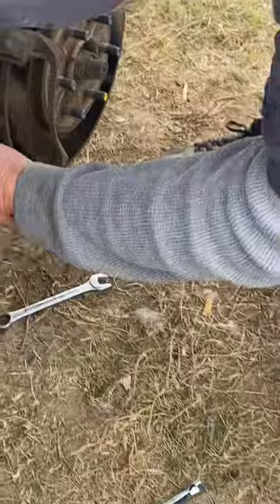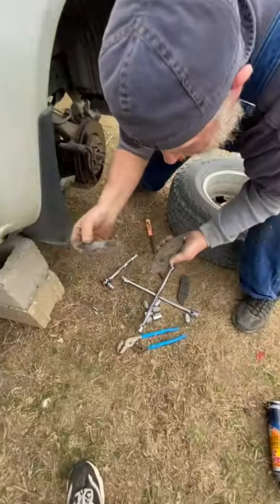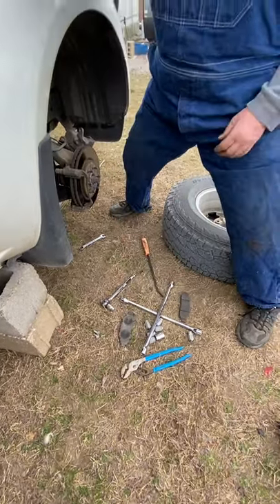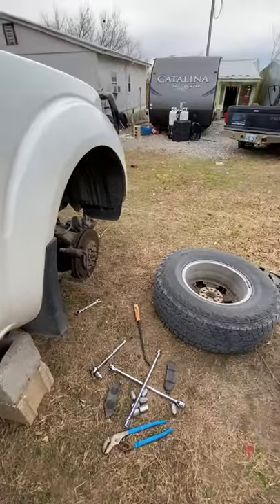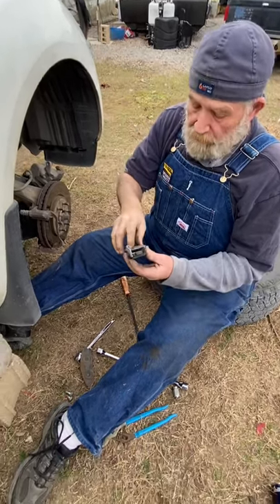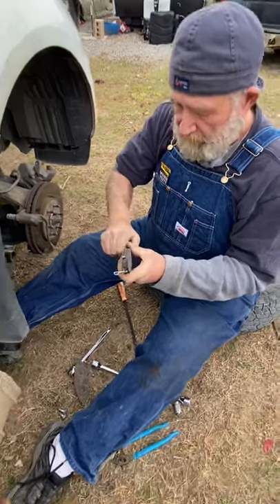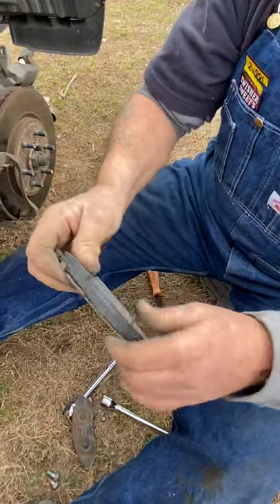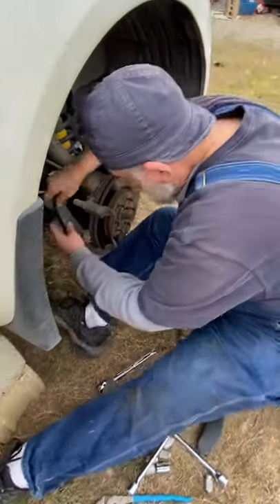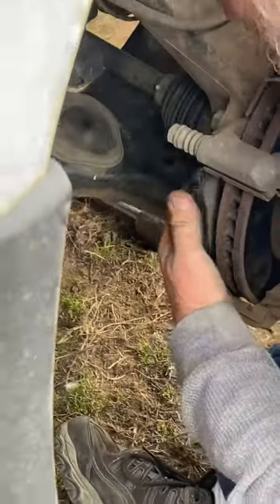That's your brake pad right there — there's the front one that goes on in this direction. Reach over and get a hold of the one in the back and pop it out the same way. Now there's a little plate on the back of these — I guess it's a squeaker plate. Here's that little pad that was on the back; it just clips on there. Make sure it gets on there good and snug so it has the same curvature when it goes back in the slides.